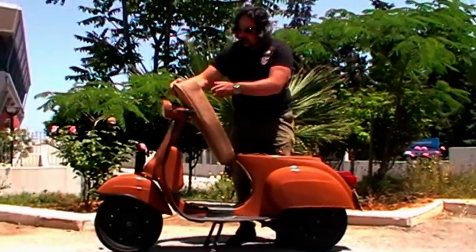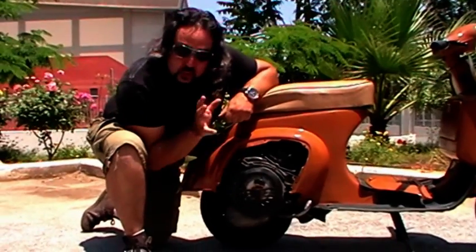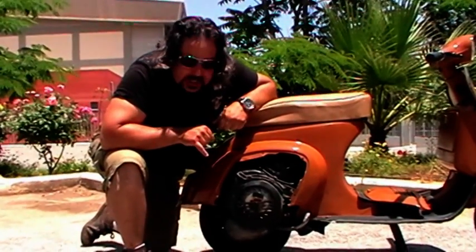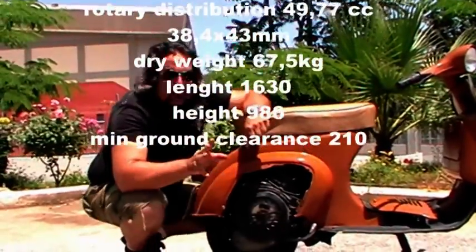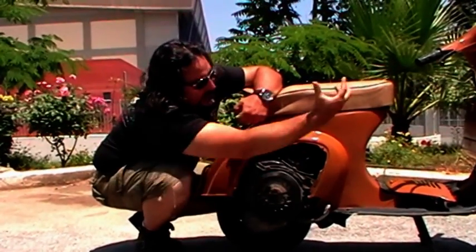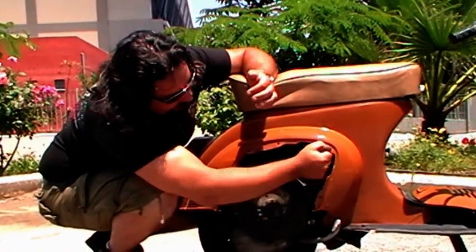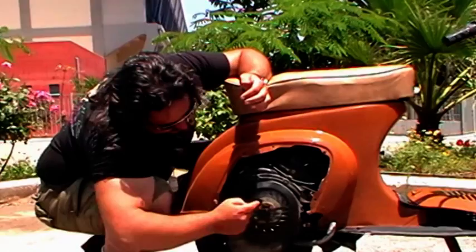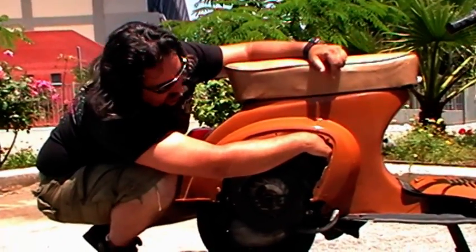Down from here is the carburetor. Here is your tank. The engine is 2-stroke. It runs as 50 cubic, but you can make this bike 90 cubic, 82 cubic, or 105 cubic. Anyway, this is air-cooled from this fan here, because as you understand the engine is in the back and there is no natural airflow — almost all the Vespas are cooled this way. The spark plug is here, the electrical system is here, and from here you have directly the drive to the wheel, and the carburetor is inside here.